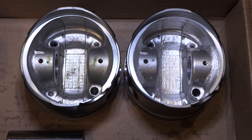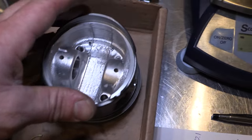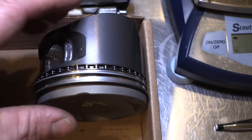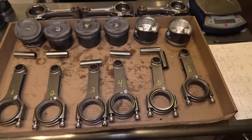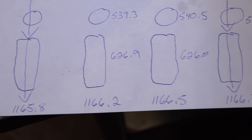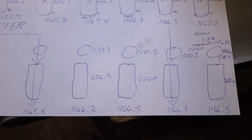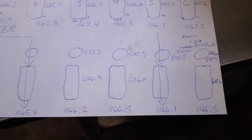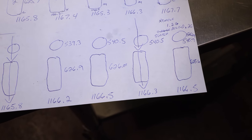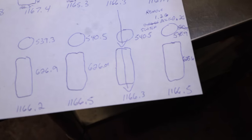I want to show you before I assemble everything the piston I removed material from side by side with the stock piston. As you can see it just looks like I polished it — kind of like porting. This is definitely the more painful way to do it, but for me it's worth it. Now for our before and after: our lowest number is 1165.8 and our highest number is 1166.5, so that is 0.7 grams difference between any one component. The actual weight may vary slightly by 0.1 grams because I'm going to put some paint on the piston to mark them, but that's pretty close and I only had to remove material from one piston.